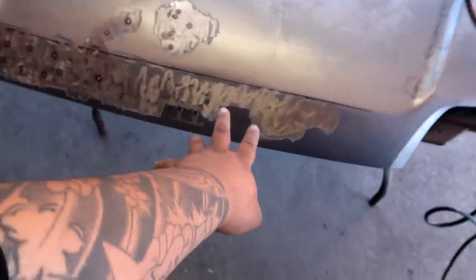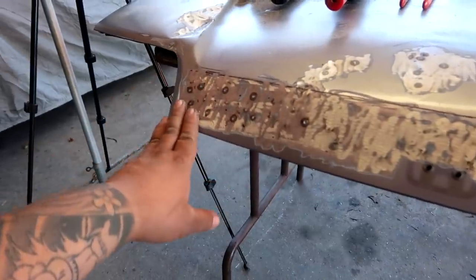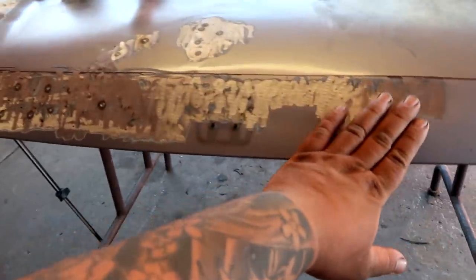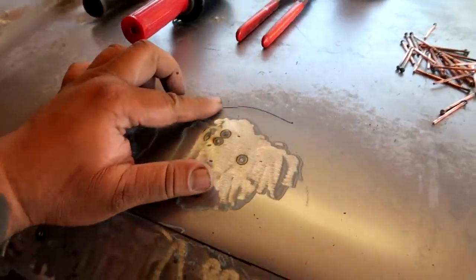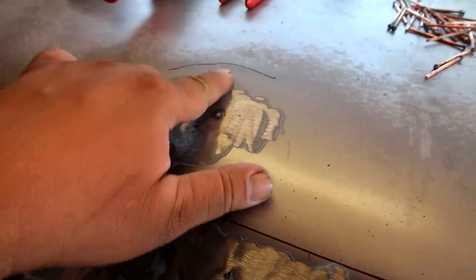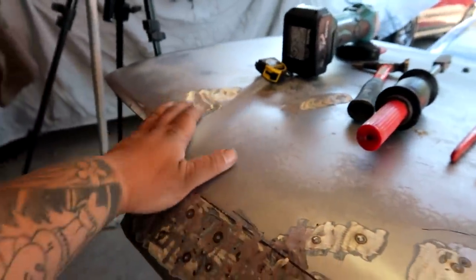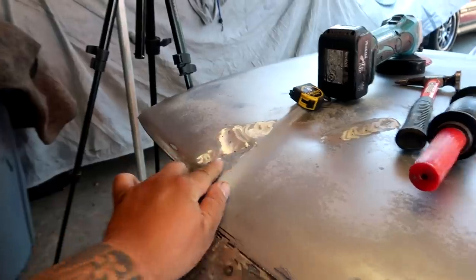I had to take a quick pause to show you guys some progress. This whole front side right here — it's not that giant dent anymore. This corner is still a low spot, but it's a flat low spot. I feel like it needs to pop out a little bit more, but it's definitely progress. This dent right here is pulled out as well. I'm happy about this one. I can't figure out if this is a high spot or just layered paint, because it is layered paint and it's obviously ground down to bare metal. There's a little lip here — I haven't gotten to the deeper dents yet because I wanted to make sure I know what I'm doing first.